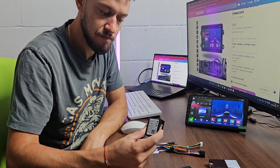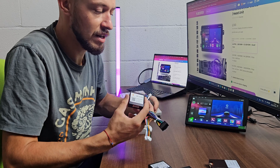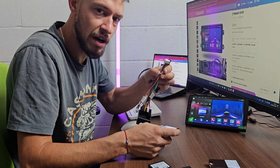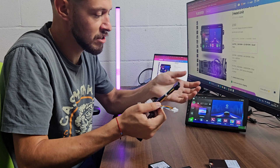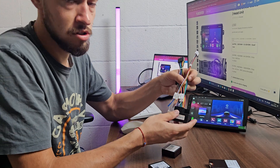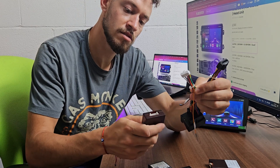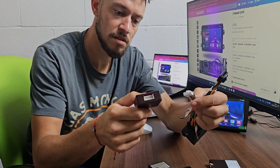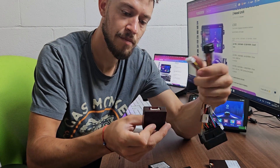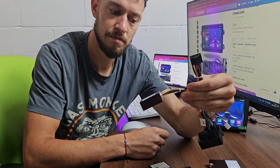When you start installing the car stereo, if you don't connect your CAN bus to the wiring harness, the car stereo will not turn on — it will not power on. So make sure the CAN bus is properly connected to your wiring harness. On every wiring harness that uses CAN bus, you can see this plug. It's the same from the wiring harness and from the CAN bus. Connect it carefully — don't break the pins, because if you break them it will not work.